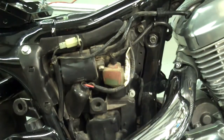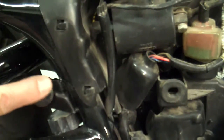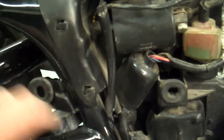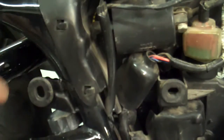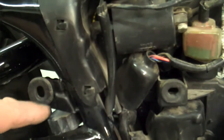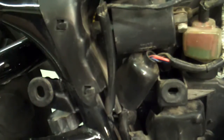It's real easy to put them on. The first thing you want to do is make sure that your rubber grommet on this flange back here is in reasonably good shape. We're just going to run a bolt through there, so it doesn't need to be super good, but you can steal this one off here because we're not going to use this one now. For all these parts for your Honda, you can go to a dealer or go to Bike Bandit or one of those websites and order OEM parts online — just pull up the year of your bike and order from there.